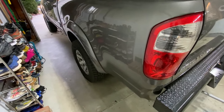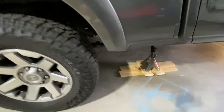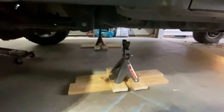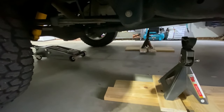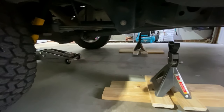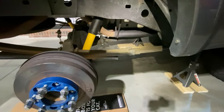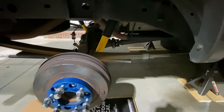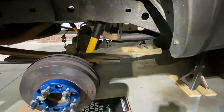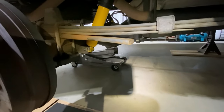We're ready to get started. The truck is backed up in the garage. First, we're going to jack up the rear end and put jack stands underneath the frame. We'll go underneath the rear differential with the jack, and once that's jacked up we'll take the rear wheels off and drop it down onto the jack stands. We've put wheel chocks in front of the front tires so the vehicle won't move, lifted the vehicle, put in the jack stands, and supported the rear differential with the floor jack. Now we need to remove the shocks on both sides — just the bottom mounts.